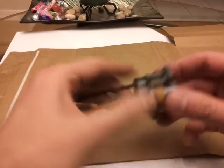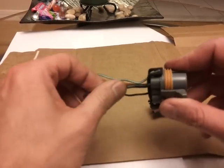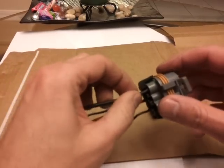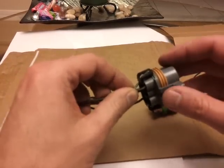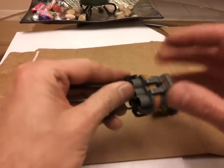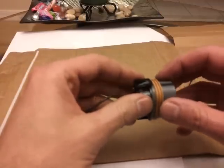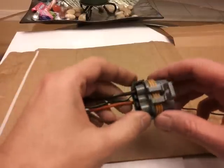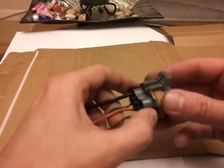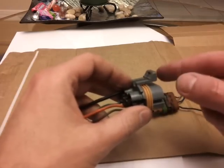There are many reasons you'd want to do this. Let's say there's a bad connection in here and it's driving you crazy and you don't want to change this whole thing. You just want to take that actual pin out with the wire and re-solder it, re-pin it and put it back in — job done. Or let's say you broke a clip and it's not really on tight, and you're getting your connector from the junkyard — you just want to change all these wires and pins into a new connector. This is how you do it.